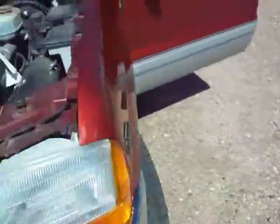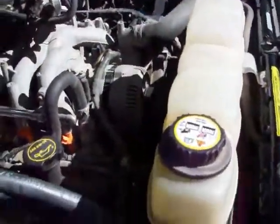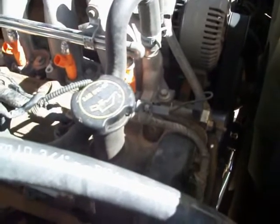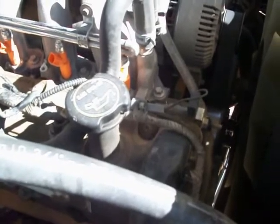We're at the point where we want to make sure that the valves are closed, because as we've seen from the drawings, the tools for the tap, the seat cutter, and the setter — well, the tap — it's an interference with the valves and the top of the piston. So we need to know that the valves are completely closed before we stick a tool down in there.